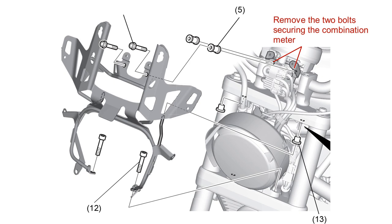It's an important sin of omission because you need to replace the stock socket bolts with the longer 6x55mm socket bolts supplied with your fairing. The longer bolts secure the top of the screen cowl stay.